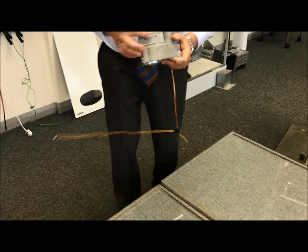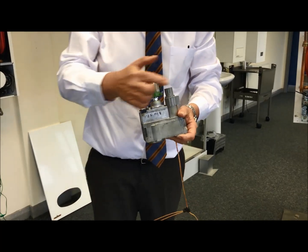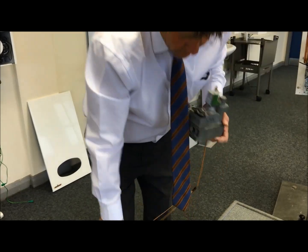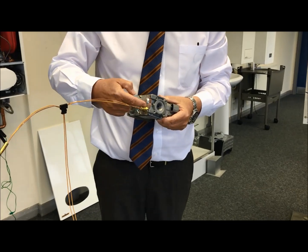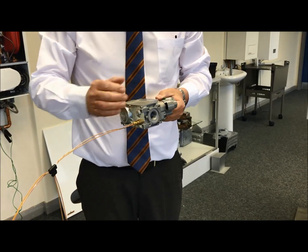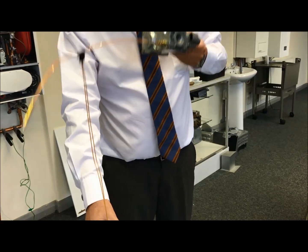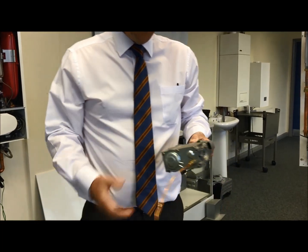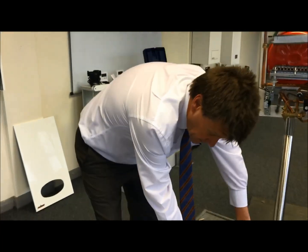On the single solenoid gas valve, you push the button down, the pilot light sparks through the ignition board, the flame hits the tip of the thermocouple, creates that signal, and allows the electromagnet inside the gas valve to keep it open. If that doesn't occur, the problem is the thermocouple, the electromagnet, or if there's an interrupter, it could be that which has failed.